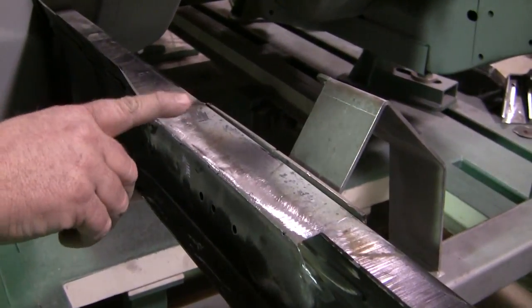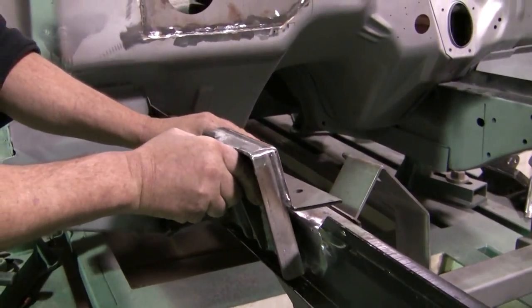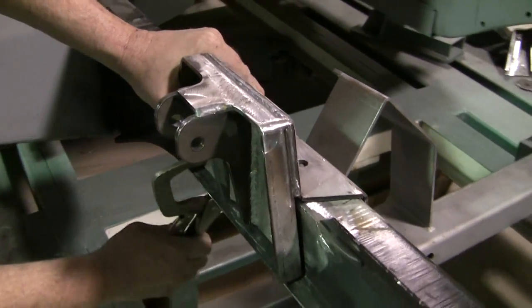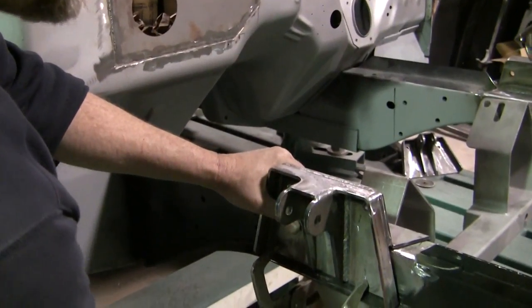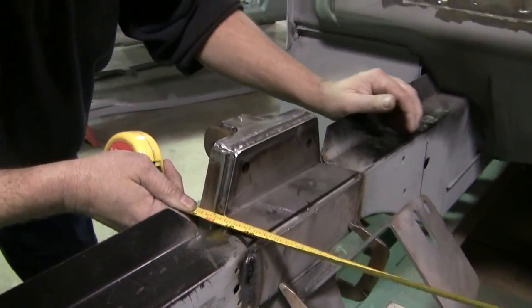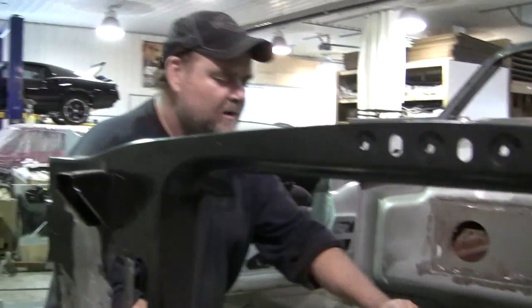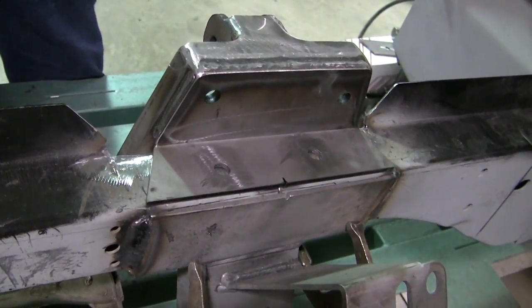As you can see we've already got our welding and our grinding done, and now we're going to mount the upper A-arm and shock mount. We'll line up the notches notch to notch and put a clamp on here to get this thing clamped in place. We want to obtain a measurement of 31 and a half inches from side to side on the inside of this — here we are at 31 and a half, give or take possibly a sixteenth to an eighth of an inch. Make sure you always have the notches lined up before welding. Get a shot of that so you can see how those two notches line up — that's what you want before you start welding.